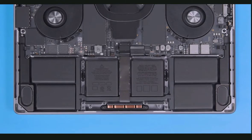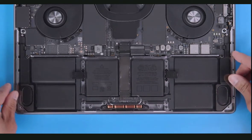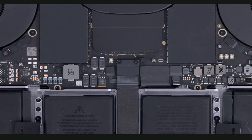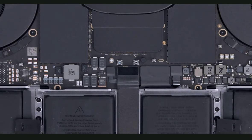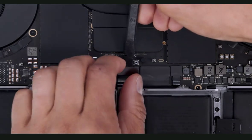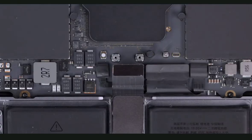If you are performing an additional repair, attach the protective battery cover and disconnect the battery as follows. Use a Torx T3 screwdriver to remove the two trackpad cowling screws. Using tweezers, remove the cowling. Then, using a black stick, disconnect the trackpad flex cable.